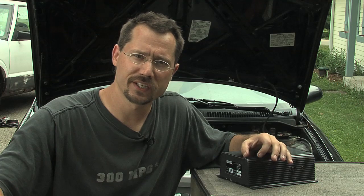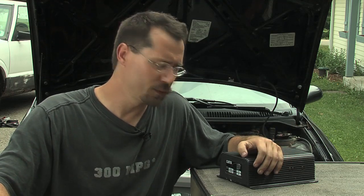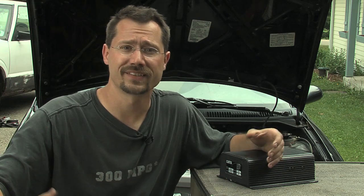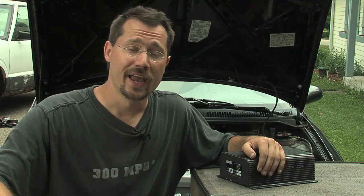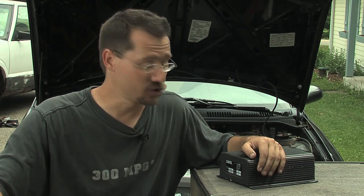This one here is 48 to 72 volts, meaning you can run it on anywhere from 4 to 6 12-volt batteries. The exact voltage doesn't necessarily mean what you'll see on your voltmeter. Usually when we talk about volts it's nominal — a battery is called 12 volts when in fact it's higher than that when fully charged and less than that when fully discharged.